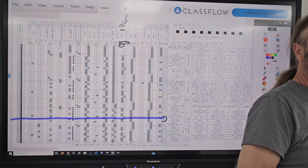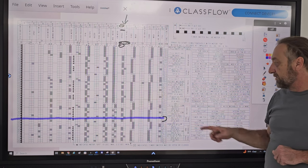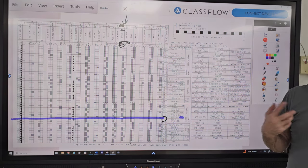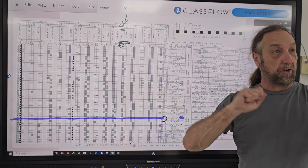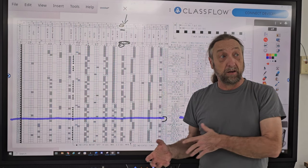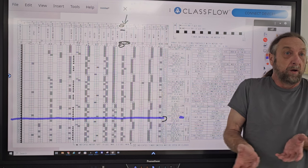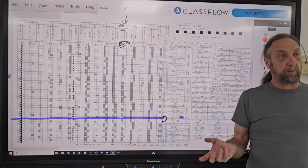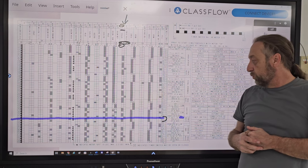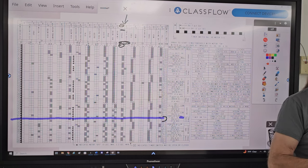Because I think it's the delicate clothes. Okay, so it's delicate clothes. So when we agitate, agitate is the same as wash. The agitator is going to go back and forth. And if we agitate on a high speed, we could damage clothes, like evening wear that people would have or something like that. We have to run it at a lower speed because a higher agitation would just rip clothes apart.